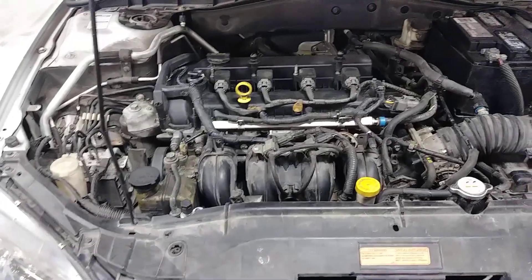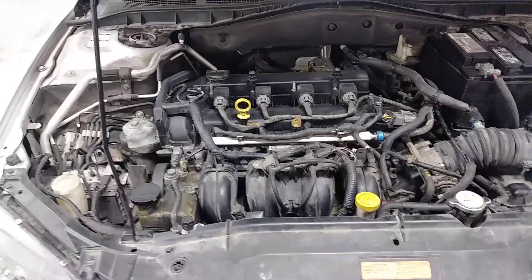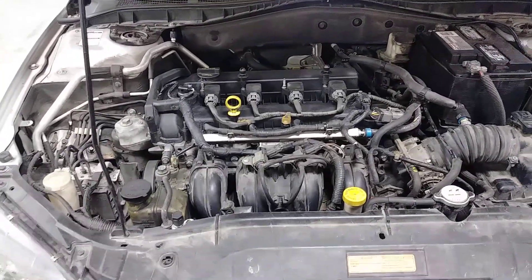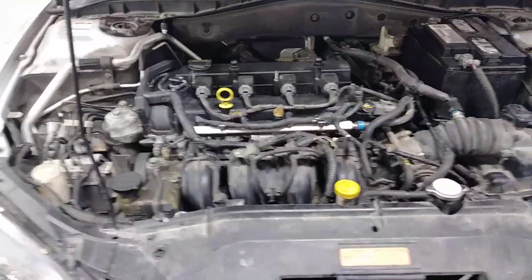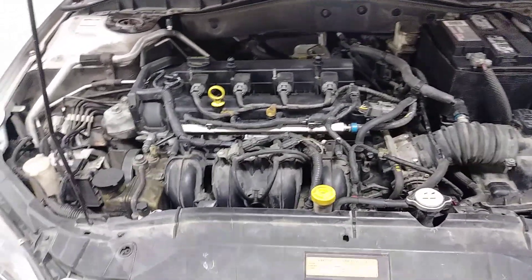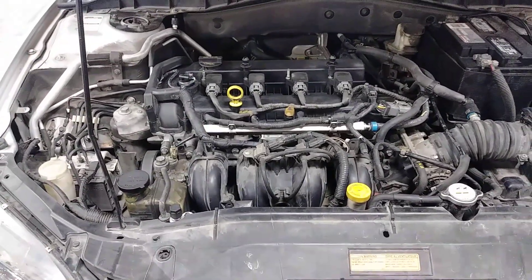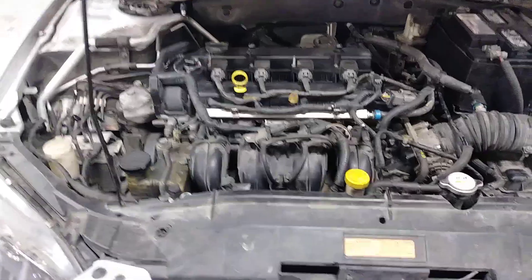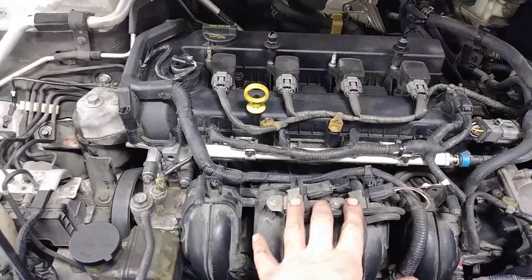I previously did a 2.5 swap in my 2004 Mazda 3s — it had a 2.3 liter and a five-speed. I put a 2015 Fusion engine in it with 10,000 miles. On that one I ran the Fusion 2.5 intake and a Mazda 6 throttle body off a 2009 2.5 Mazda 6, and did some modifications to keep the check engine light off.